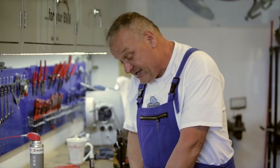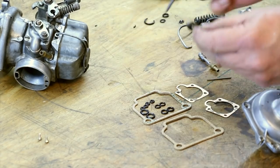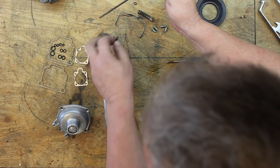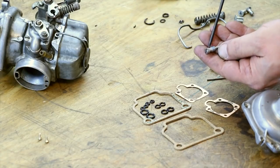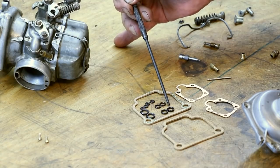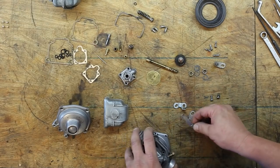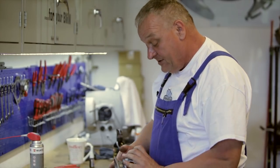Now let's put things back together. Here are the gaskets that come with the kit. The two large ones go on the main jet holder right in this position. These four that are all the same size — two go on the idle jets, two go on the air screw adjuster. That leaves these four: the larger ones here are for the throttle butterfly shafts and the smaller ones are for the choke shafts. I've cleaned these parts up and now we'll start with the throttle butterfly.